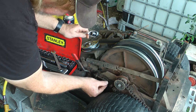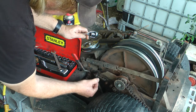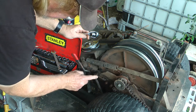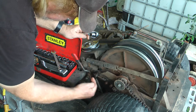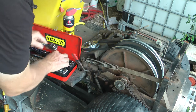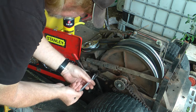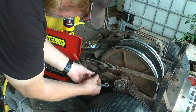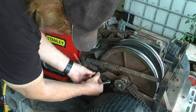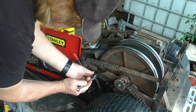It's just a matter of loosening them so the shaft is free, and then this is your adjustment. We obviously want it to go that way to put more pressure on the chain, so we need to turn this one towards the front of the mower. So we'll loosen that to give us the distance we need, and then adjust it — push that forward — and that's just the lock-nut setup.